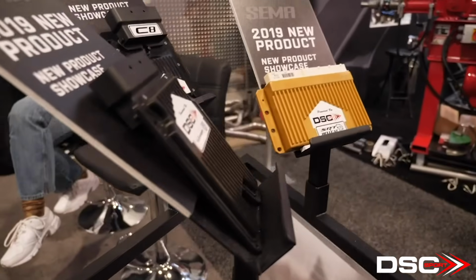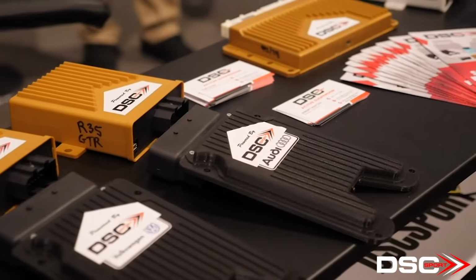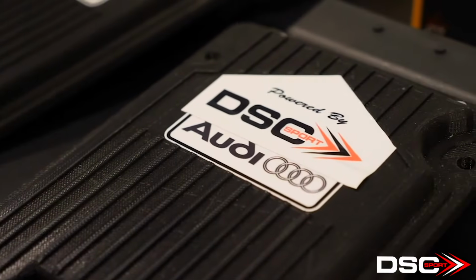All right, so again, we talked about the conventional manual bump and rebound adjuster, and at some point we're making compromises. Maybe it'll work really well in a section of corners, but there's another set of corners that maybe aren't quite ideally suited. So you've got the ability to change the bump and rebound dampening as the car's going around the track, and this is where your DSC control module comes in. So before we get into the logic behind that control, what sensors are required in order to use this system?